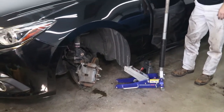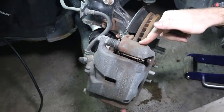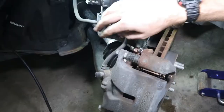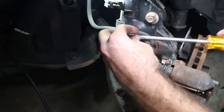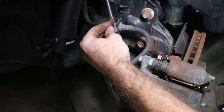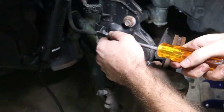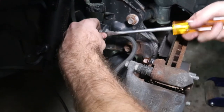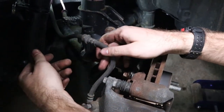As for the braking system, you have your actual caliper mounted into a bracket. We're going to take the caliper off first, but to avoid damaging the brake line — it's flexible cabling but you don't want to stress it — there's a retainer clip right here. Take a flathead screwdriver and work it out, whatever way works for you. Pull it towards you and it slides right out.